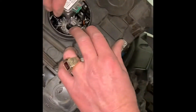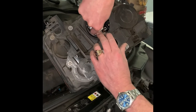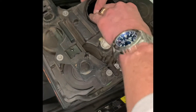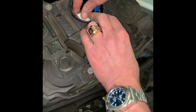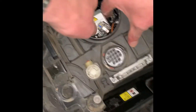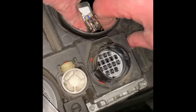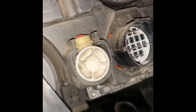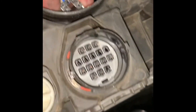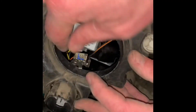Here's the good bulb — just gently put it in there. You should be able to push on it because all of those little metal tongs around it hold it in. Then you push the plastic part down once it's all the way seated — get your fingers in there and push that plastic part down. It's difficult. Make sure it's seated all the way — there you go, click. You hear that click? That's it. Then you get in there and plug it in.